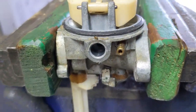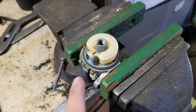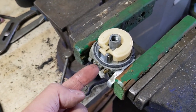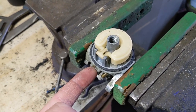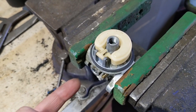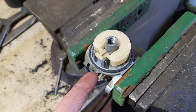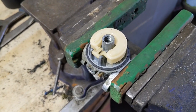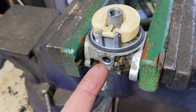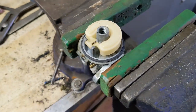At this point the brass insert is out, and I would highly recommend cleaning your carburetor now, because if there's any gunk built up behind that inlet — in between the seat and the inlet — it will be difficult to get out once you install the new 90-degree fuel inlet. I know that Donnyboy73 did a video recently showing that on some carburetors there is in fact a screen behind some inlets.